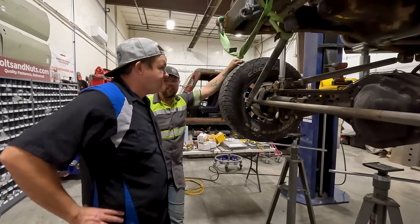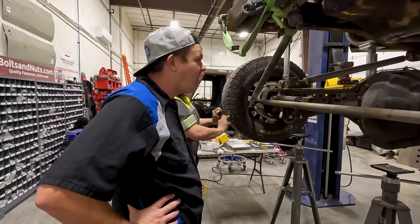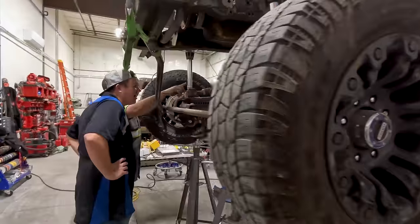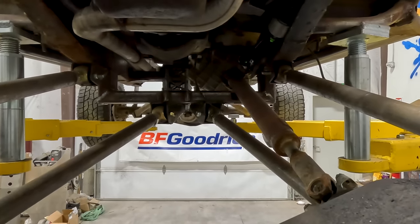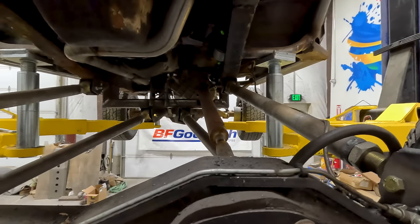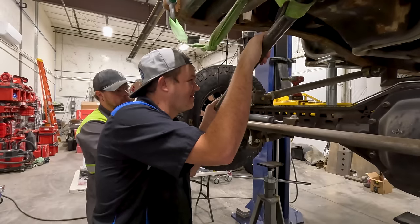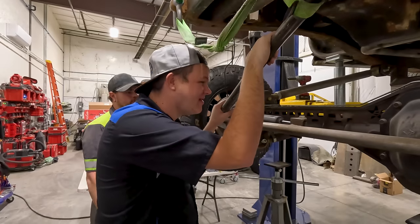For eyeballing the driveline, it's pretty close, but we only rub at one little spot because it's not completely straight. It's pretty unbalanced, so I'll have to take the driveline off and grind down the thing a little bit. She's not very straight, but I've built many a derby car that's been way less straight. I'll just take the driveline off, grind that notch to where it clears when it turns. That's full droop and we're barely rubbing — we did something correct.